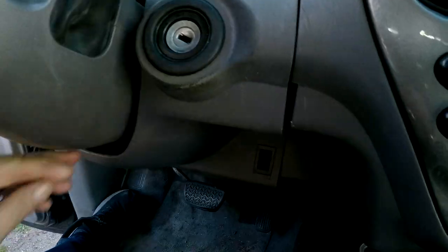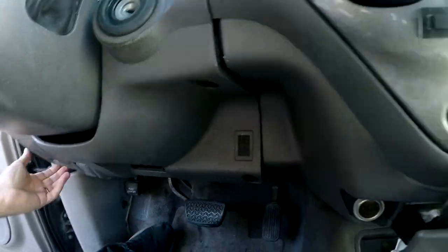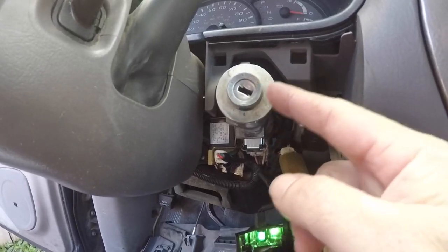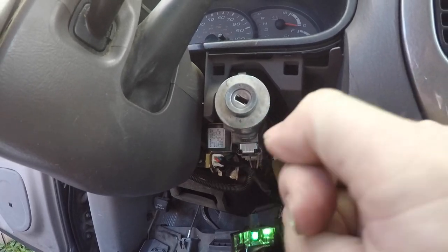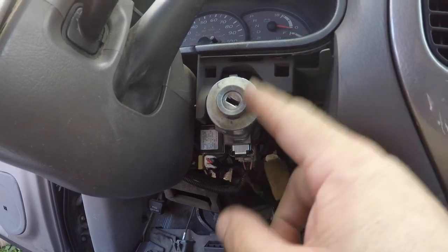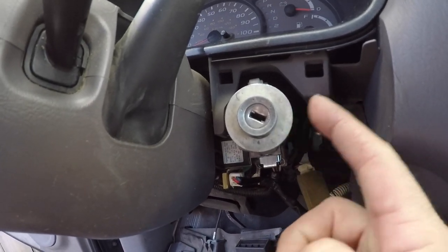I've already unbolted some things here. There are basically four 10-millimeter bolts you have to remove and then you can pull this whole panel off to lay eyes on the actual issue. The lock cylinder has broken, rendering you unable to turn the key when you put it in the ignition. We need to replace this because we can't turn the key, can't turn the car on. But in order to remove it, you have to be able to turn the key — if you can't turn the key, you can't press the release button underneath to slide the cylinder out. Toyota has designed a system that, when broken, can only be fixed if it's not broken.